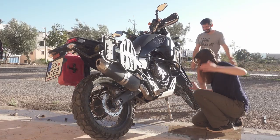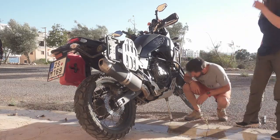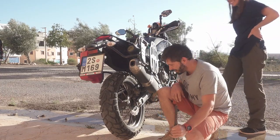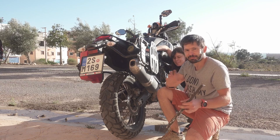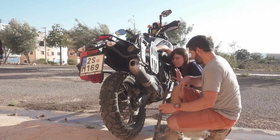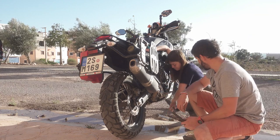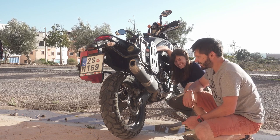It totally does work on the Tenere! It is stable, but obviously it's not the center stand, so you have to find a really solid and strong position for it if you're taking wheels off. Give it a bit of a wiggle before you actually take any wheels off, and make sure you loosen everything before removing wheels. That's the quick video on trail stands and the crutch jack — see you next time.